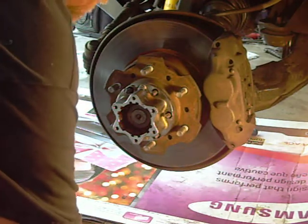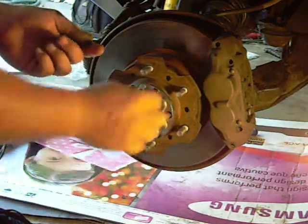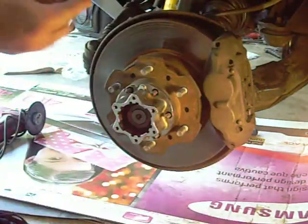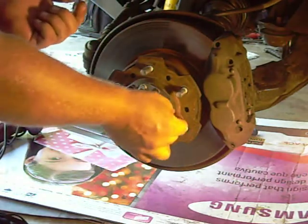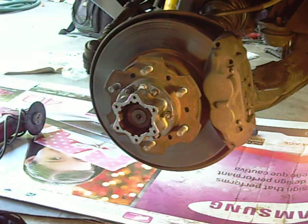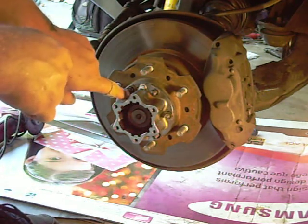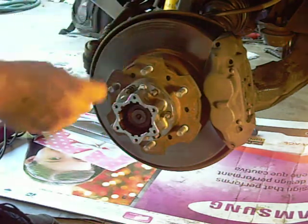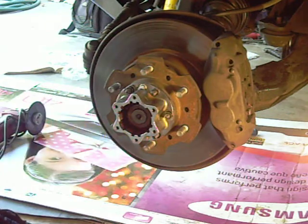First thing that goes in is the cone washers. So you slide a cone washer in — lightly greased on the outside, and the inside if you have a Q-tip — and that way they'll pop out easier. Just put a nut up to the end of the stud. Some of them don't want to slide in so far because the previous owner of these hubs banged on the edge of the hub to knock the cone washers out. It's better to do it on the stud ends with a nut, even with the stud, because then you don't bugger up the edge of the hub. They were tight in there when they came out, so they're under a little tension and as they go in they'll lock in a little bit. You can tap them in slightly, or just wait until you get the nuts on.